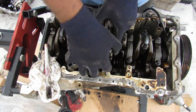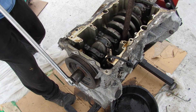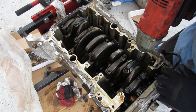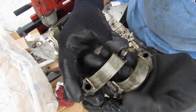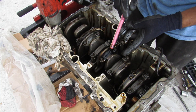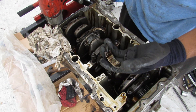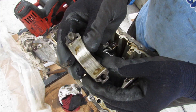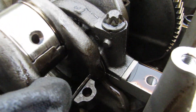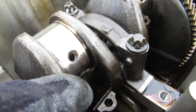Now I'm going to remove the balance shaft assembly — that's what it looks like, and it's got quite some weight to it. Pulling this pulley off — E10s for the connecting rod bolts. Check out the wear on those connecting rod bearings. This thing definitely ran out of oil when the oil pan broke. Check out how much darker this connecting rod cap is compared to the other three — this definitely burnt up a bearing. There isn't even a bearing on there, and this bearing is also pretty roughed and scored up.